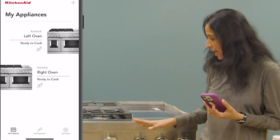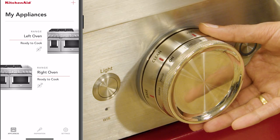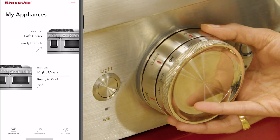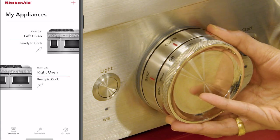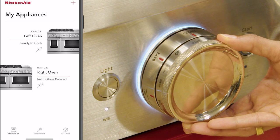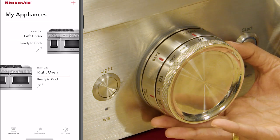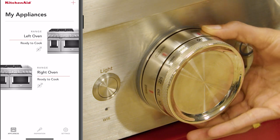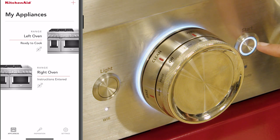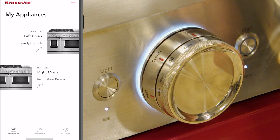To enable remote, we have to go to the actual physical appliance and use the control knob for the right oven. We always have to start from the clean and off position, so I'm going to put the outer ring in the clean position and the inner ring in the off position. Now I'm going to turn and keep both rings in the Wi-Fi position, and in a few moments you will see the start button blinking — we are going to quickly press it and release it.